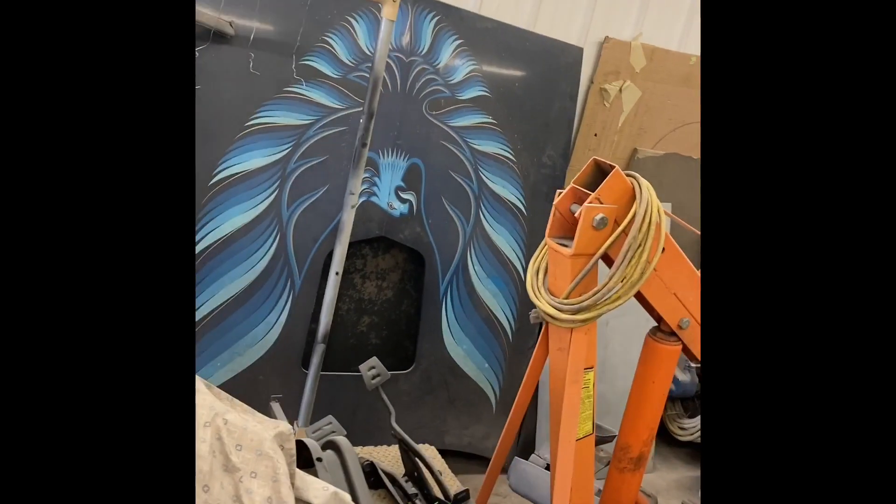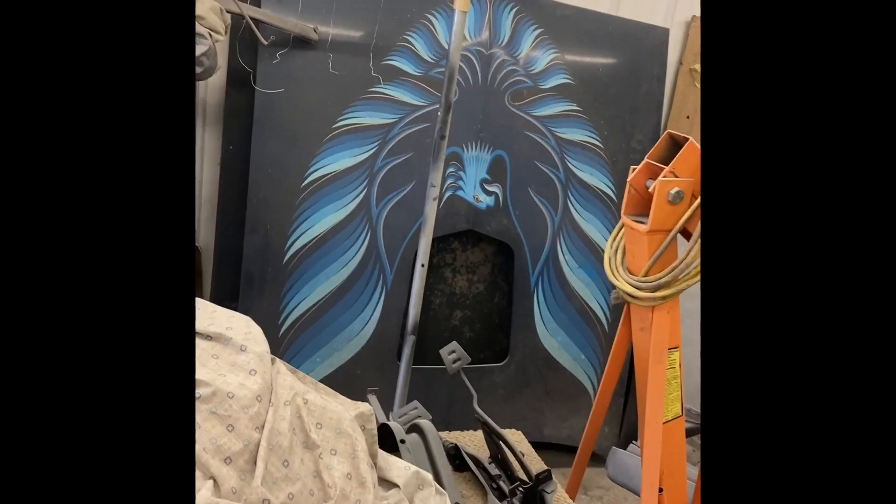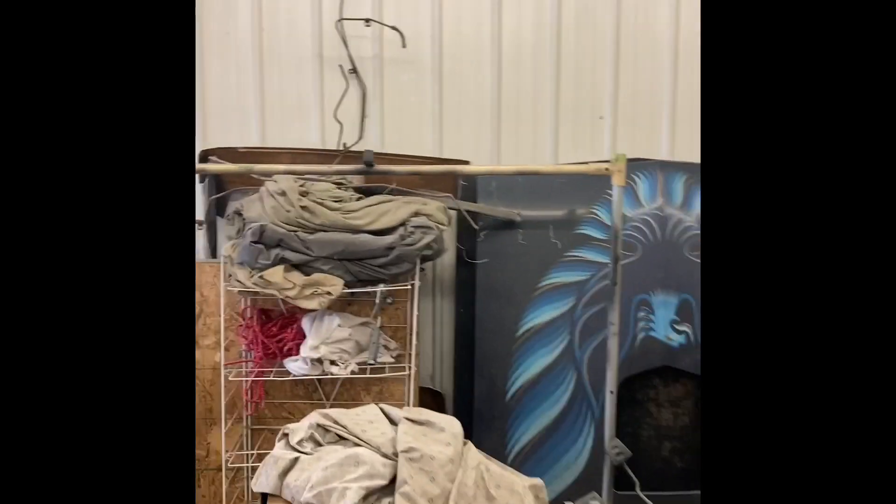I've got the hood to do, and I think it's the last piece of metal — it's fairly straight, just one little ding in it. And then the flares. I'm going to save those for the very last thing, because I hate sanding flares. They're that ABS plastic urethane, whatever they are. I put 80 grit on a DA and sand those down and remove everything.